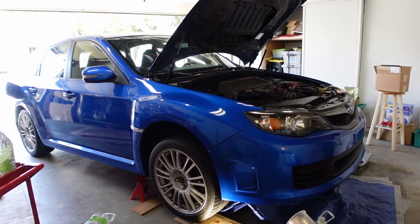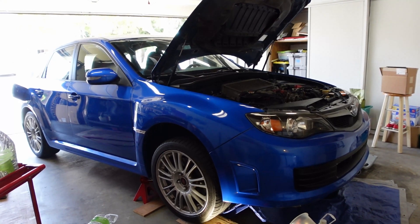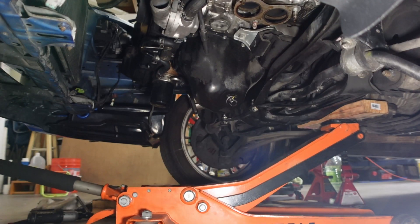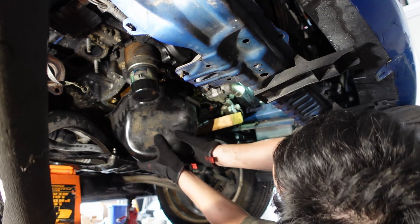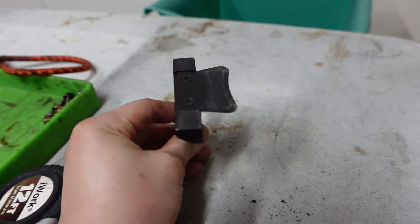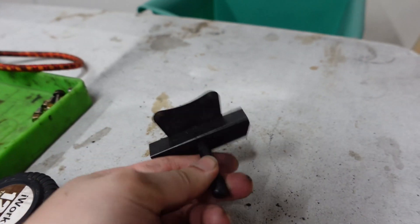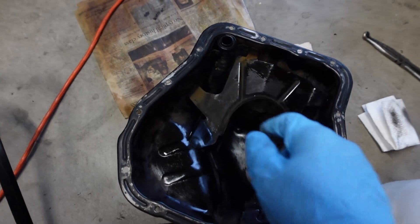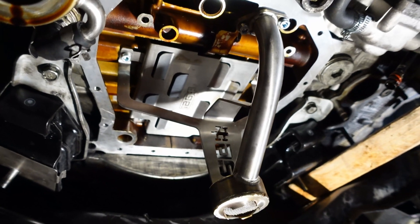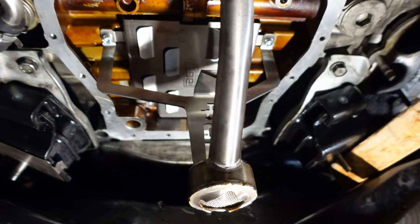That's a job well done. My tips for doing this job: loosen the engine mounts and lift the engine for clearance. Remove the headers as well. If the oil pan has never been touched, removing it is going to be a major pain because the OEM RTV is like cement — but removing the engine mounts and using the oil pan separator tool helps. Clean the sealing surfaces of the pan and block until there's no RTV left — very important. Overall, the job isn't that bad. Have fun, good luck, I hope you enjoyed it.